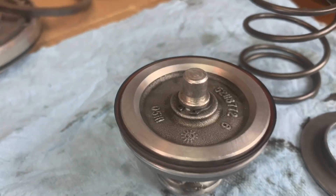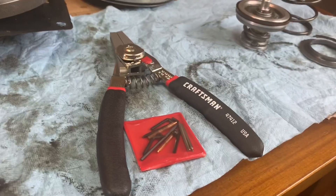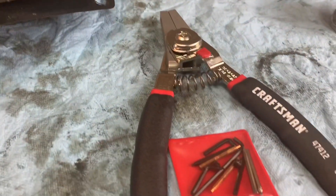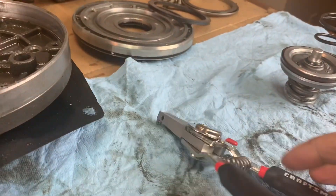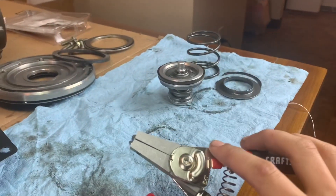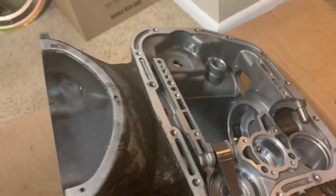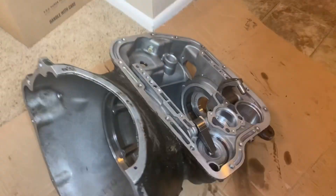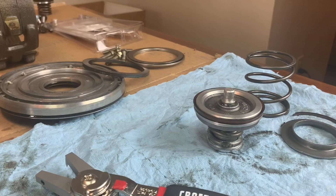I got that snap ring back on — it's assembled and has the spacer in it. I ended up having to go buy another set of snap ring pliers; the ones I had just have two big tips on them. I got a nice set of Craftsman with interchangeable tips in different sizes — works pretty good, I'm happy with it, and I like that you can reverse it too. I also installed the orifice plug down in the case from the TransGo kit, and I'm going to get to putting the rear servo back in and keep going on the build.